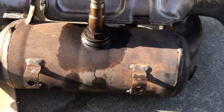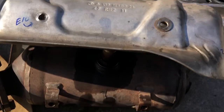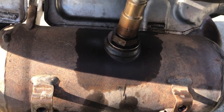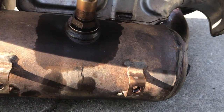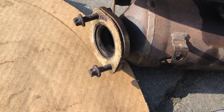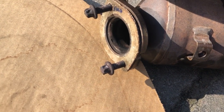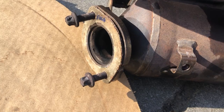You can see where it's just kind of tensioned on there — it's like a clip. So once you get these off, then you can get the rest of it off. It's a 21 millimeter to take off the downstream O2 sensor, and then there's the other O2 sensor port right there. These bolts here connect the exhaust system like the muffler — if you have an OEM unit, that's the bolts, and there's the gasket in there.